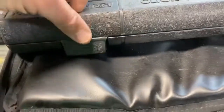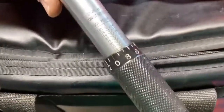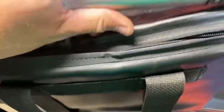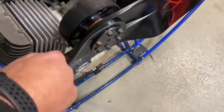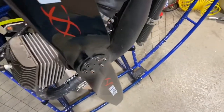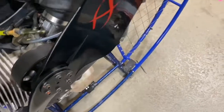It's a precise piece of equipment, so always make sure you put it back carefully. And don't get the big torque wrenches like this one, because I don't think this one goes down that low. This is for my work on my cars - that's foot pounds. It starts off at 13 and a half newton meters. The only takeaway is to be very, very patient - go around and snug them all slowly. There could be impatient people that will crank down on one side too much and break a bolt. I did that, so be very patient.